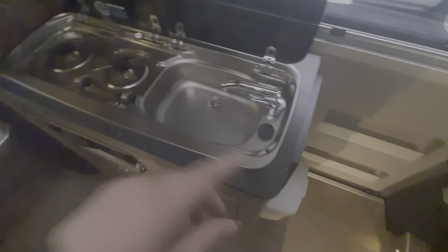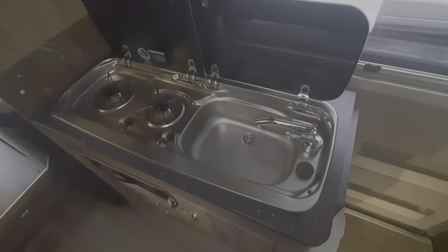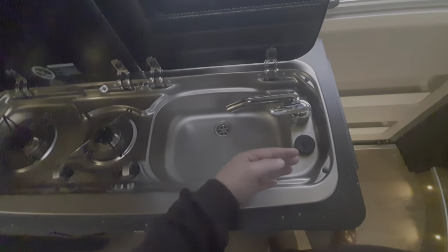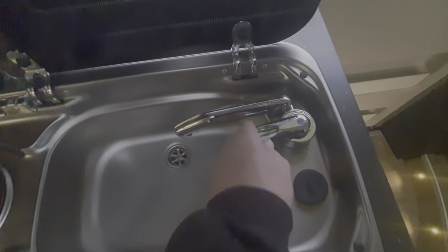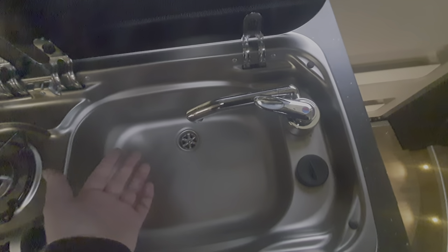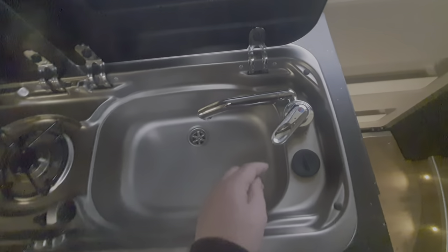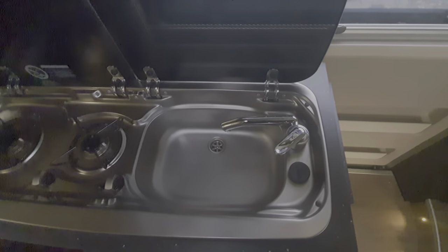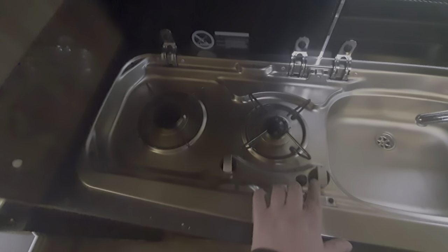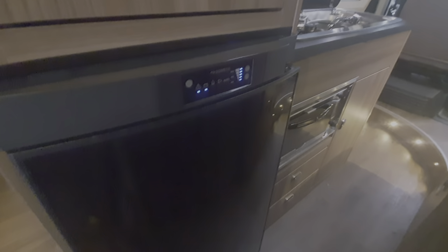Next to the draw-across door here is the hob and sink. When you first put water in, you need to run the tap to purge the system — flick it across to the hot side and wait until you get a pure flow of water, which means all the air is out of the pipes and through the boiler. Do the same on the cold side. The gas hob is straightforward — the igniter is there and the two controls are there.